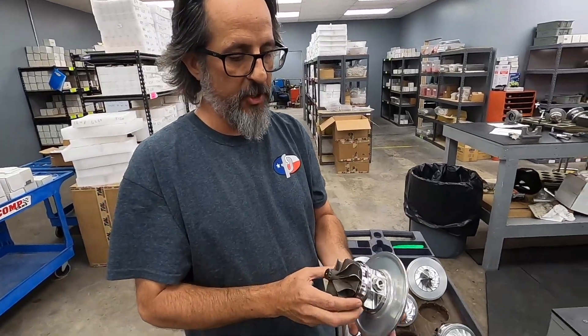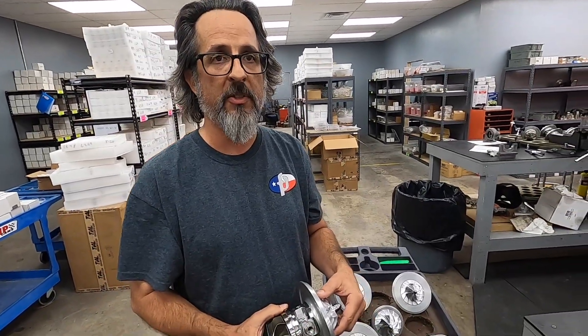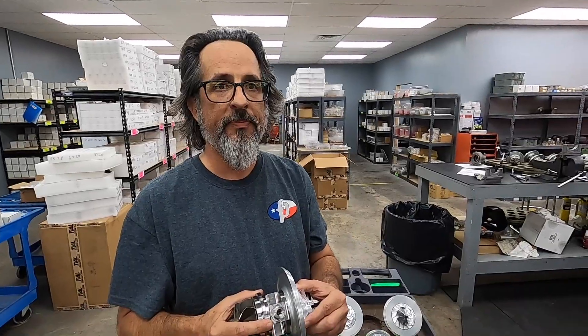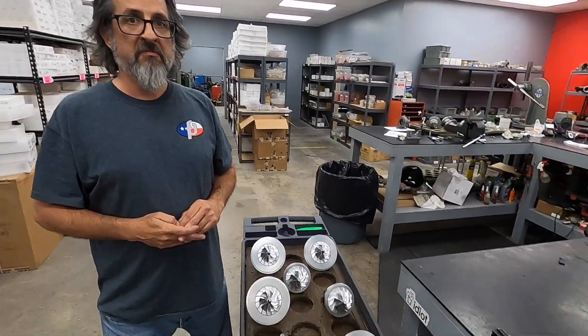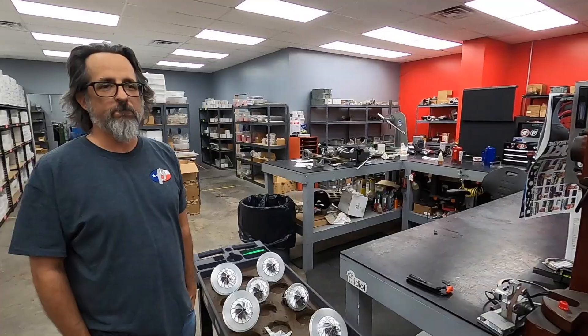This is an 8269 64S — a very popular 800 horsepower turbocharger on 4-, 5-, and 6-cylinder motors. This turbocharger is rated at 82 pounds per minute, meaning you can flow 82 pounds per minute out of it 24 hours a day, 7 days a week, and it's expected to still operate reliably for a year. That's how effective the coolant jacket is at extracting heat. It's quite calculable whether or not you can handle the thermal load.